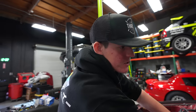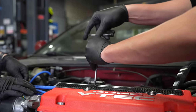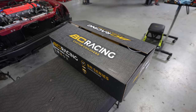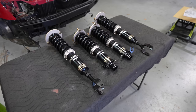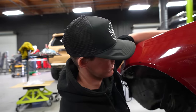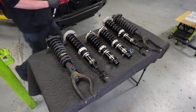Let's get our new carbon fiber coil cover on and drag the wiring harness over to wire up our alternator. The engine is just about finished. The next step is to get our axles back in, but to do that we have to put the rest of the suspension together. We're starting with BC Racing coilovers. We're going to start by taking the old struts out first, since we already have these corners blown apart. The lower sections we're taking off, cleaning, and painting black so they look nice, then we'll put them back in and start getting the uprights and all our new control arms on.